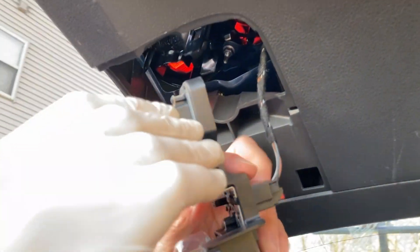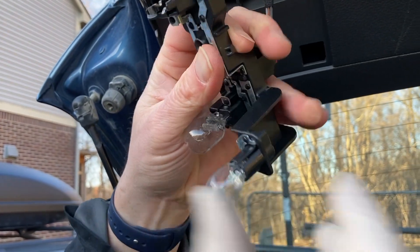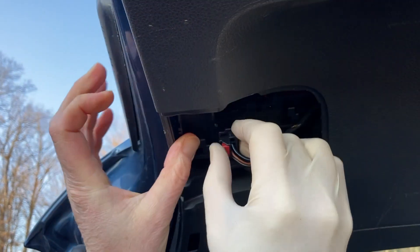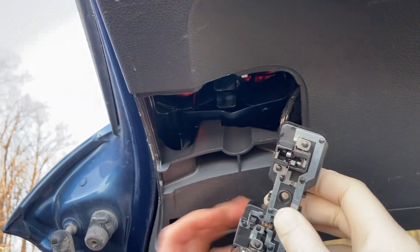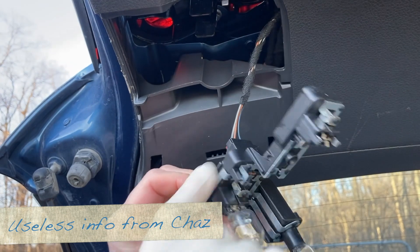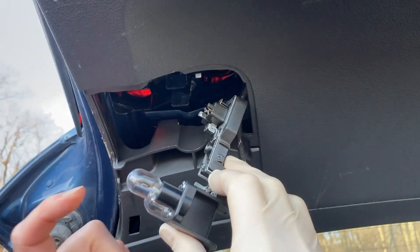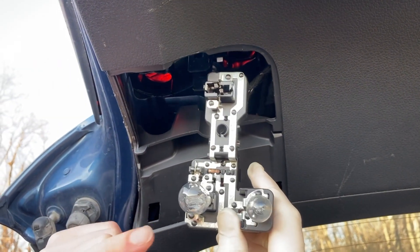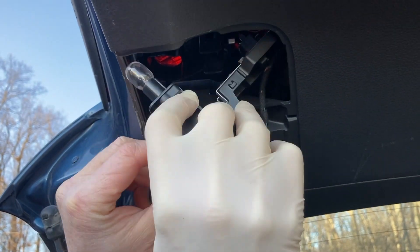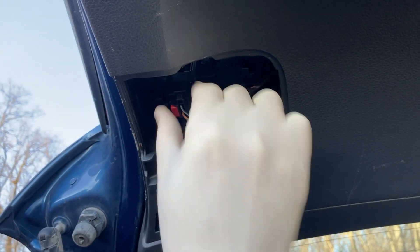Stick the new bulb in right here — feels like it's in. Now stick it back into the hole. This looks like there's another bulb socket that could go in here, but this part is probably universal across different Volkswagen models, so a different model may use that socket. This one doesn't — it's just the regular tail light for braking and running lights, and then this is the reverse bulb. Stick her in there — it clicked, give it a wiggle, it's good to go.